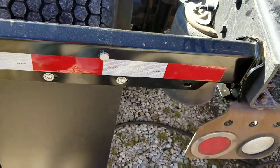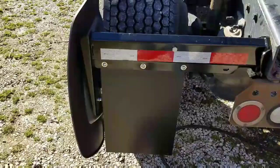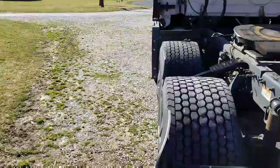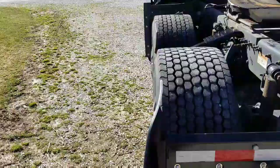When you call them, you give them your bolt spacing and the distance from the frame to the outside of the tire — that's why your mud flap bracket will be positioned right. I cut down the mud flaps since they would have stuck out too far; I have super singles instead of duals, so it was just catching air. This is the diverter that shoots air past the landing gear. You can kind of see where the airstream is going to go. Nice setup — I think I'll really enjoy it.